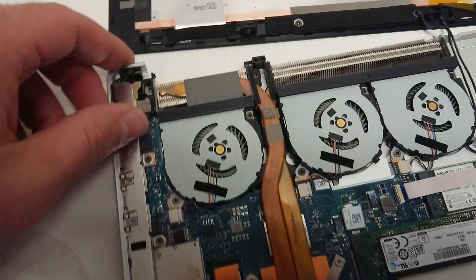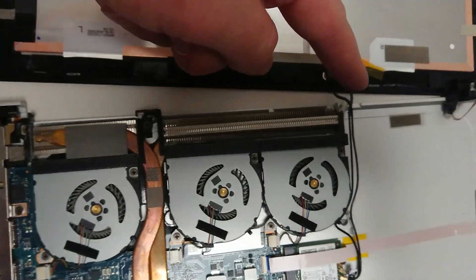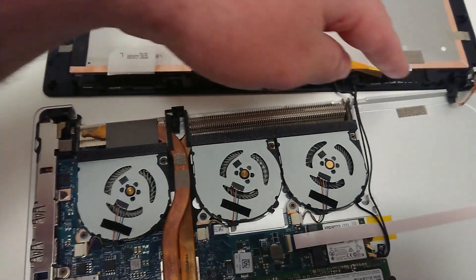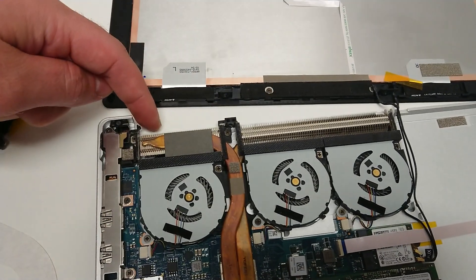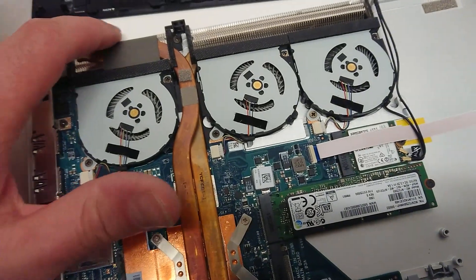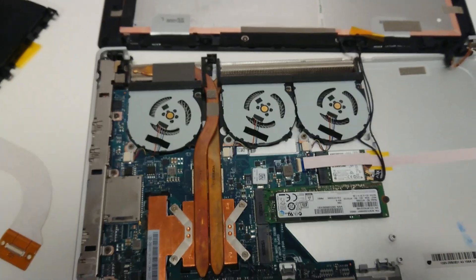The most annoying thing is — I can't really see it too well here — but there are three little screws that are essentially inside the top grate. You'll see them through the grate, so if you're looking at the top of the tablet where the fans vent, inside that vent there are three little screws. Once you take that off, a little piece of plastic comes out, and at this point the device is ready to be taken apart.